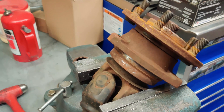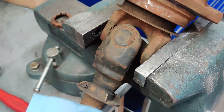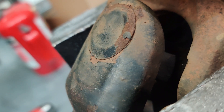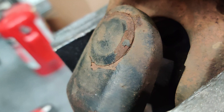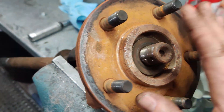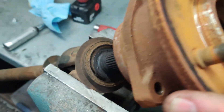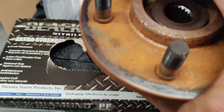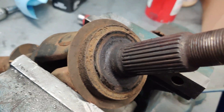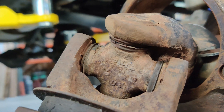The other reason I wanted to do this portion on the bench is to show you the movement that is not normal for the axle shaft u-joint. That right there is not supposed to happen — it's supposed to be completely tight. Next step, after you get your axle nut off, go ahead and take your hub and disassemble it from the shaft. Do not lose this washer — very, very important. And here's my bare axle shaft. Yeah, this joint has definitely seen better days.